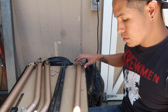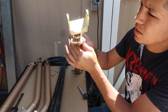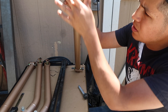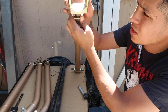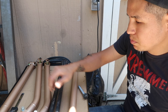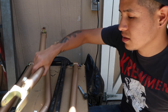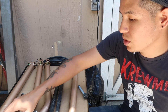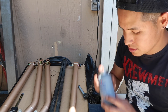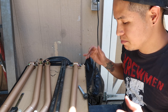After you're done setting that up, pull the old arm off. You set this nut and bolt — that'll lock the inner threaded sleeve that goes into the arm, and then you lock this guy which locks the actual mounting part that goes to the arm. Repeat that with your upper control arm. And don't forget to put anti-seize in there — you don't want it to freeze up later when you want to make an adjustment and can't get it off.